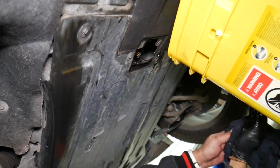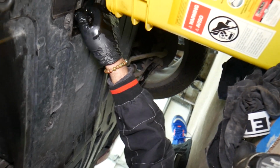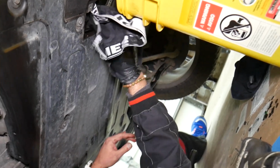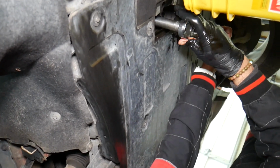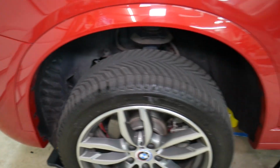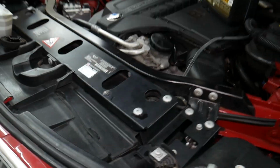Okay, let me pass right here a rag to clean. Okay, we need to tighten that thing. If you want to see the torque specs for the drain plug, I'm going to share that in the description of the video below. Don't overtighten it, you can damage the oil pan. If you undertighten it, it can come loose. We've seen that happen, guys. People lose a drain plug, and as a result, okay, that's perfect. They run out of oil in a few minutes, less than a minute. Sometimes when the engine oil is hot, the engine starves for oil, and you just destroy your engine, guys, and spend thousands of dollars on repairs or engine replacement.